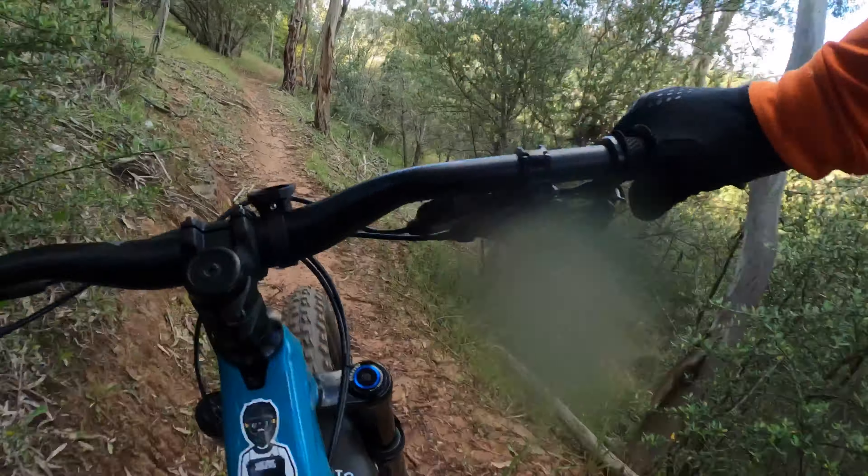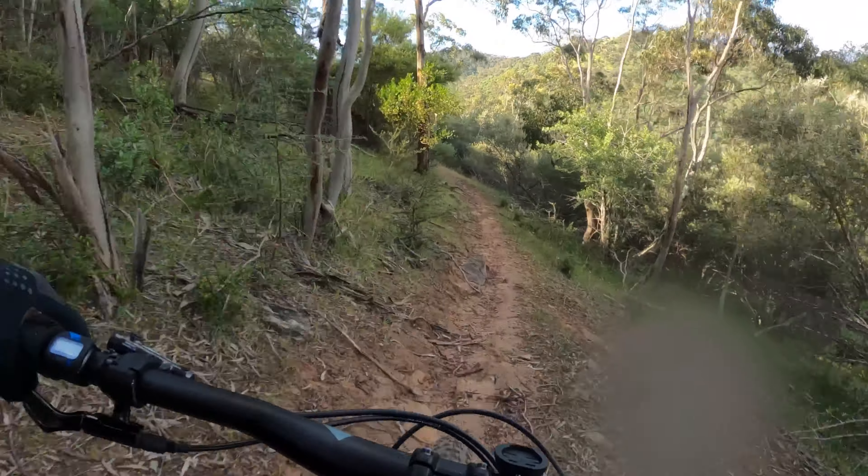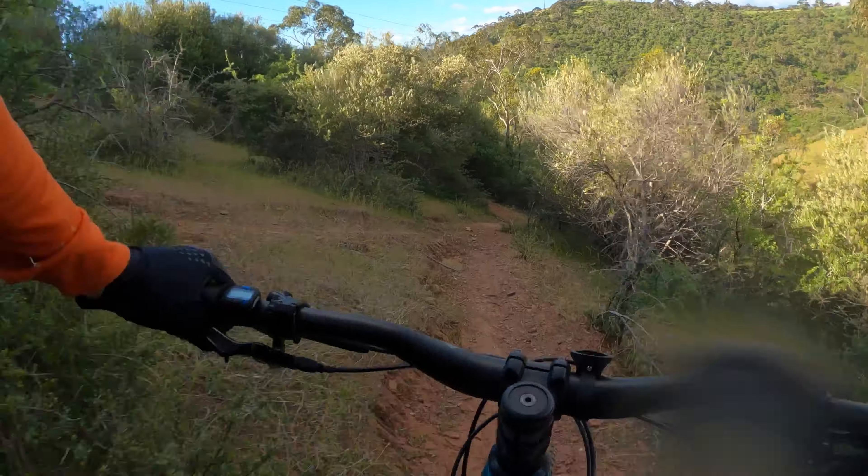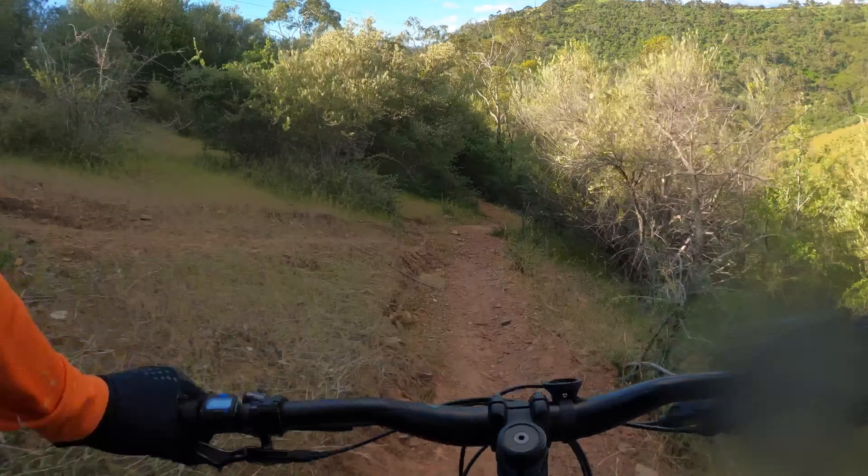So far this Lyric is killer - which I already knew, it's always my go-to. The B1, the C1 is similar to the ZEB C1, so not too much to say about that one. Another thing to note - on this service on this Lyric I used Castrol Magnatec motor oil instead of the RockShox oil. We'll see how that feels - so far, so good, feels butter smooth, really really free moving, maybe more free moving than the RockShox gear. I was put onto it by a friend who liked the improvement.